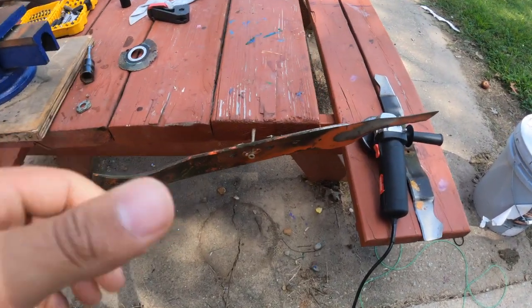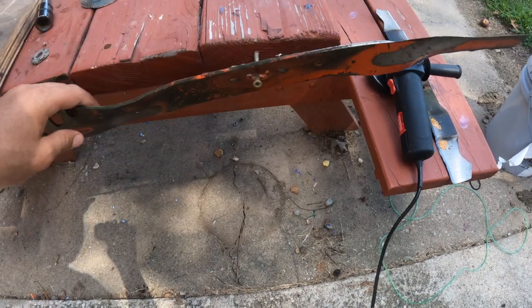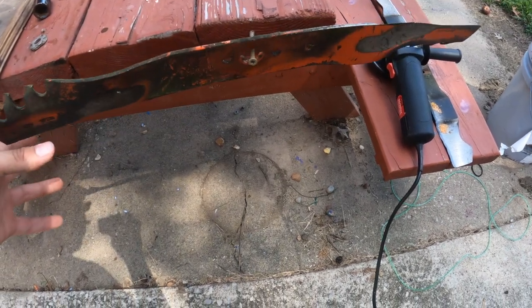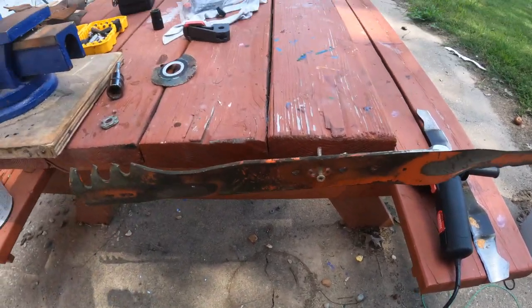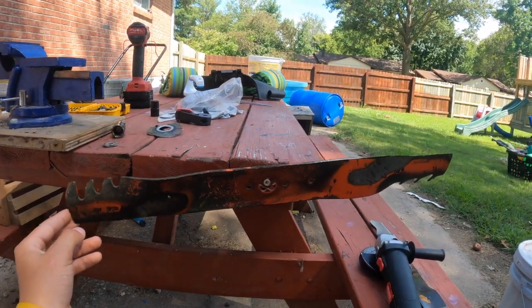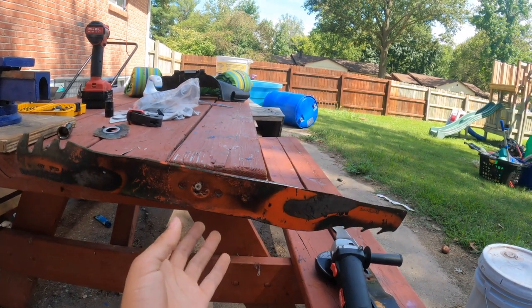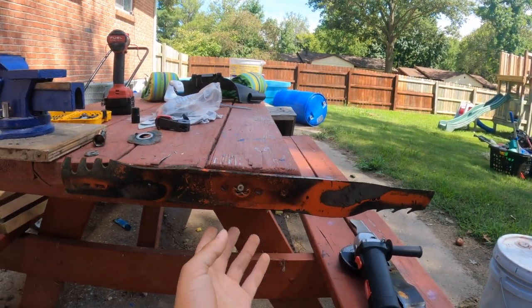When you are sharpening your mower blade, you want to hang it up on a nail or a string at regular intervals to see whether it is level or not. If it's not level, like this, that means you need to take more metal off of the side that is lower so that your mower blade will be balanced and sharp and ready to go.